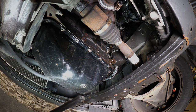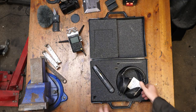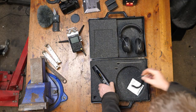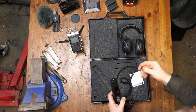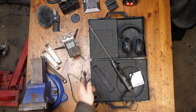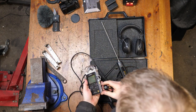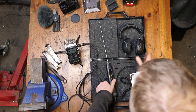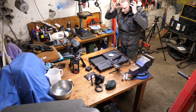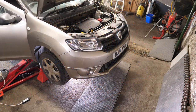Not sure what that's all about. So, time for a stethoscope I think. Doing YouTube can get a little bit expensive, because instead of just using a normal stethoscope I've had to go for an electronic one because it's got an output socket so I can actually record what I hear — otherwise it's going to be very difficult to record a normal stethoscope. Anyway, we've hooked up a recorder, put the headphones on, and we'll see if we can get a recording of this engine knocking sound.